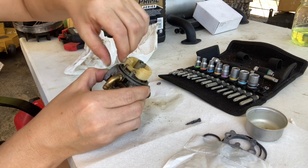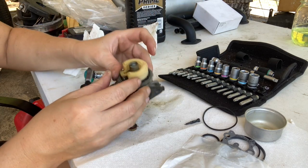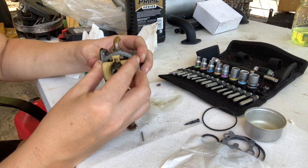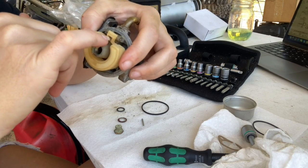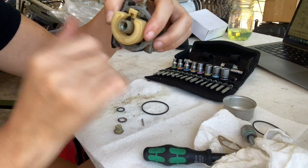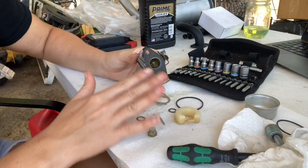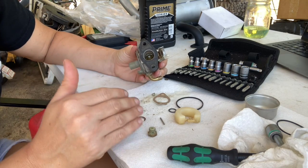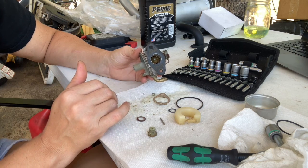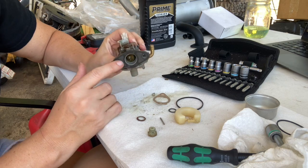We're going to give the bowl a good spray with carburetor cleaner. Be careful when cleaning these out — this is very light aluminum and you will bend it and it will not seat correctly back on the carburetor if you squeeze it too much. Next we take this old bowl gasket off. The float is stuck — when you have a stuck needle, be careful of that little metal bracket over the plastic prong on the float. We don't want to break that prong off. Put a little spray in there and jiggle it loose. Now let me go over the parts you'll want to purchase. The mounting gasket is part number 791718.